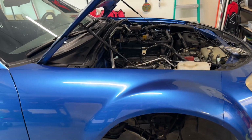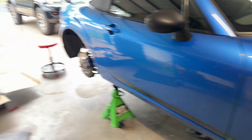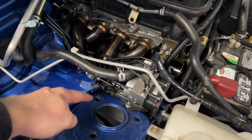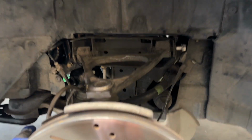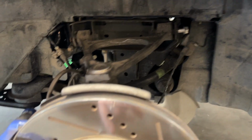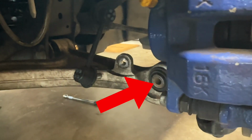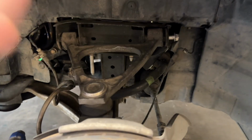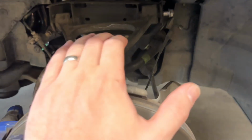But as far as suspension uninstall tips, as far as removing your suspension, wanted to give just a couple quick pointers here. So we'll start up front. Obviously you need to undo the 3 bolts on each side, and then down below, the only bolts I found you need to remove are the bottom bolt holding the strut in, and then the lower end link is pretty easy to get off down there, and that allows a little bit of movement. And then your upper A-arm, getting those 2 bolts out will allow enough room for the whole front assembly